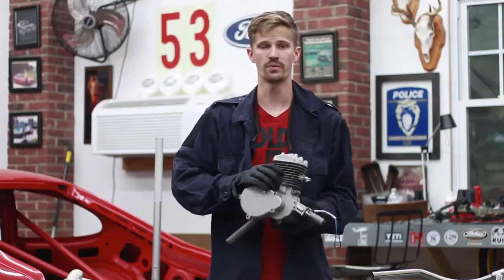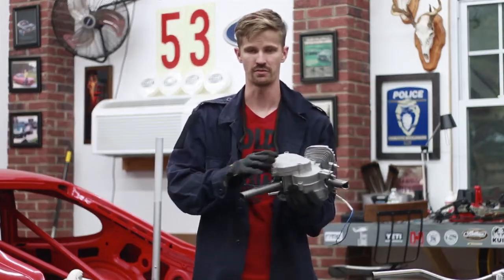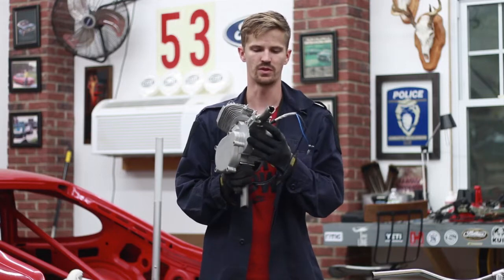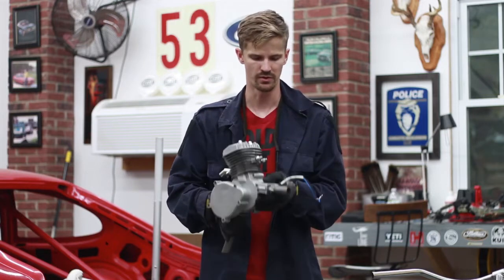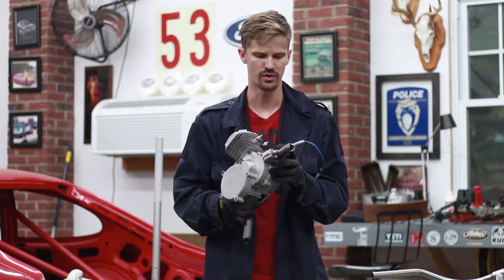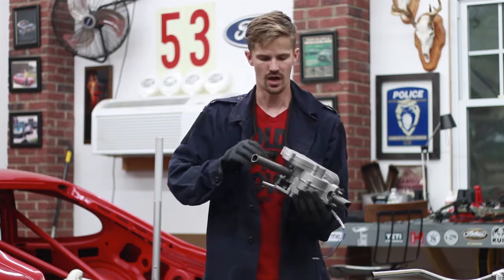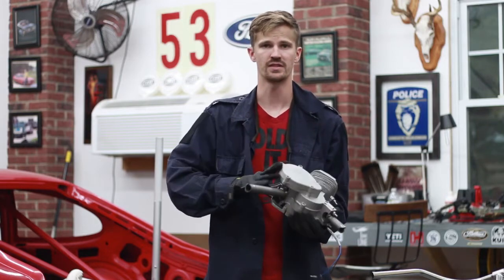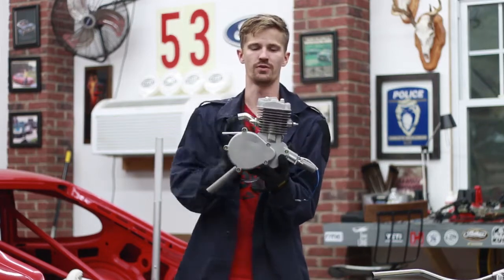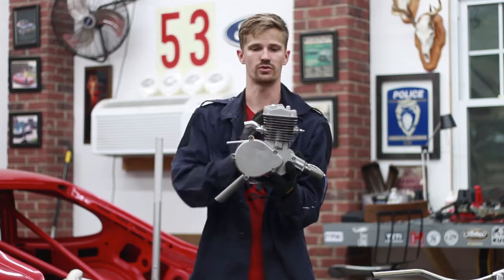Alright, so to catch you up on where we are, we've gone ahead and made the front and the rear motor mounts, and we've shaped them to fit. We didn't quite have enough room to put full beads around the front or the rear, so we put four really solid tacks on there. I'll probably go back and add a little more. But then we shaped them out, and essentially I want the piston to sit vertically, so we got these lengths so it'll sit upright.